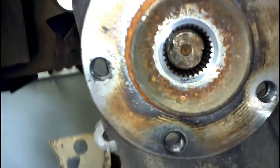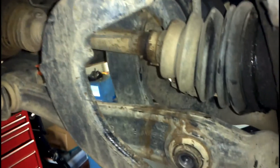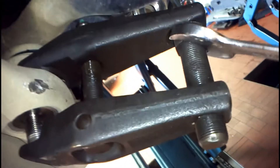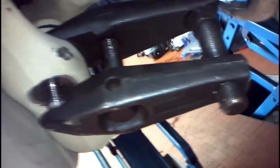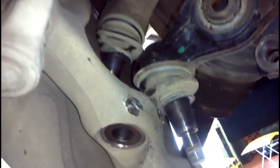We used the special tool to get that shaft out of the bearing and out of the threads. But we've also needed to take out some of these control arms because you can't get enough leverage on the joint to pull it out. That's a 21 mil nut and bolt. A lot of these things you have to redo with the wheel back on with a bit of pressure so that the bushes don't strip out. I've got the ball joint separated tool. These ball joints are really well in there, so just bashing on the bit where the ball joints are doesn't usually work. I finally got those joints out after tightening it down as tight as it would go and then bashing it with a hammer — the two combined seemed to make a difference.